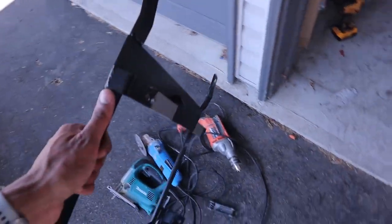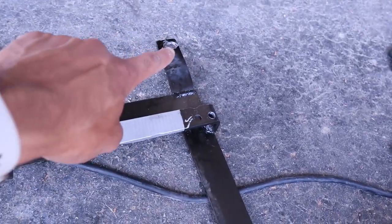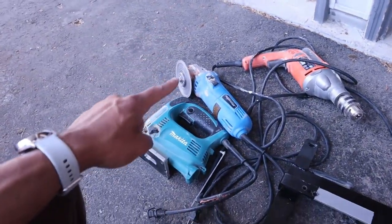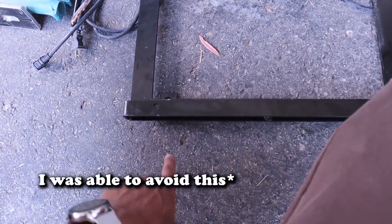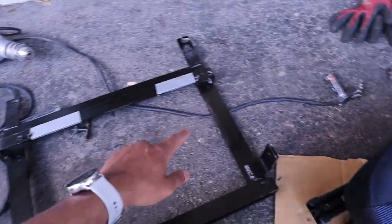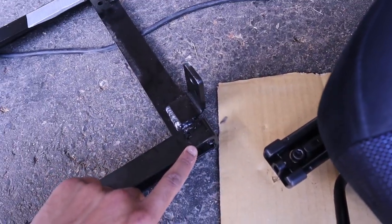After quite a bit of work — a few different bolt holes — I tried slotting these to one side but did it wrong. I'm going to slot them a little more to the left. I need the holes as far right as I can because when I test fit the seat I wasn't centered; I need to go closer to the center console. I also have to weld brackets on sticking backwards because the distance doesn't line up with the seat rail holes. I'll cut off the piece that gets in the way and then do a test fit in the car.